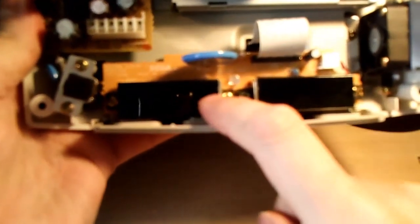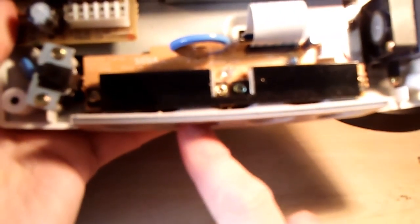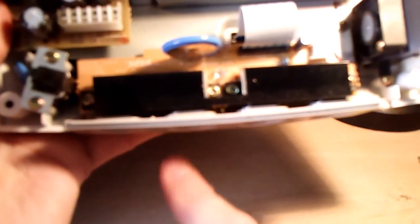You're going to find one at the back of each port connection underneath this cover here once you remove the screws. Now, let me just say, some of you are going to say, oh no, don't do that. Bottom line, when you plug in a non-Sega brand controller, a third-party one, a cheap one, whatever, it may be sending a signal, a slight variance in the power or voltage, I don't know, and that's what caused the resistor to blow and took out your ports.